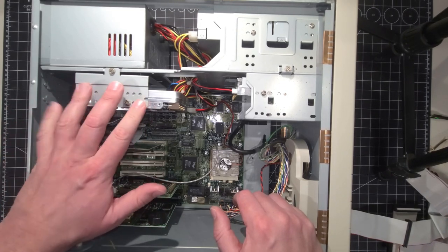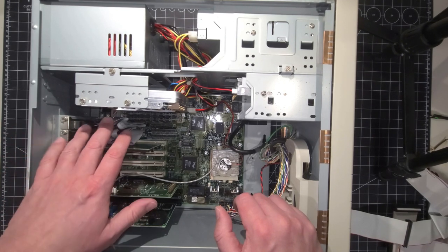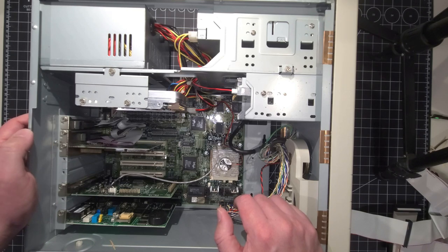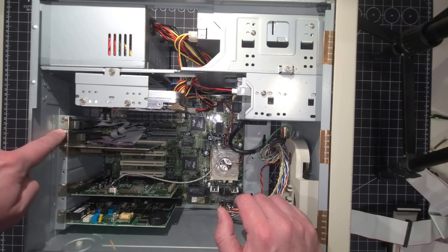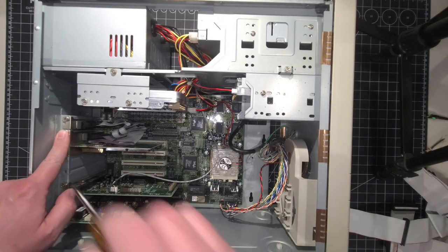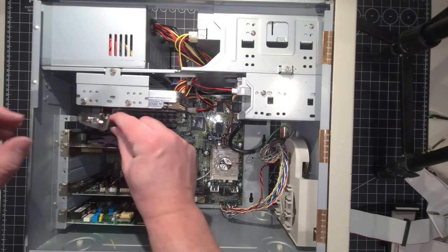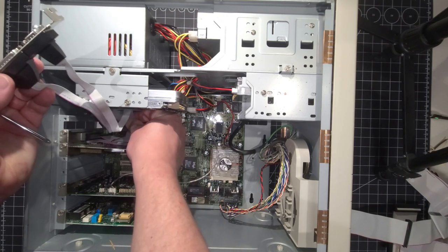Not knowing what the hard drive size is, I am going to take that out and show everybody. So this case comes with breakout cables for your printer and comm ports one and two. We're going to go ahead and start with that and just remove them. Theoretically I don't have to remove them because the case will come out from behind, but I am going to anyway for good measure. I've already taken a picture of all this so we know how to put them back together. This is comm ports one and two that I'm going to be removing from the motherboard.